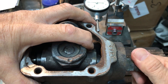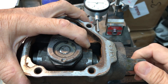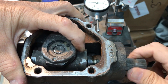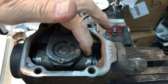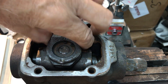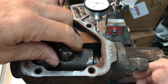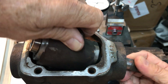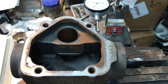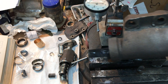Now, this is what happens when you turn your steering wheel. Your steering wheel is attached here — the steering column is attached here and a couple of feet up is the steering wheel. This is what happens when you turn your steering wheel: it moves back and forth. Any slop or wear in the steering worm, or the shaft and the bushings inside here — here's the bushing right here — any wear in those is going to be magnified by the time it gets out to your wheels. So a little bit of wear and tear right here is magnified when it gets out to the wheels.